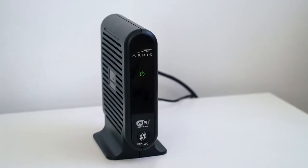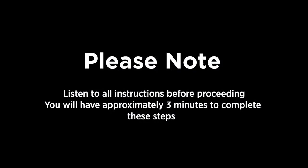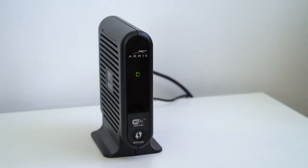At this point, return to your video access point. It is important to note that the following steps will need to be completed quickly. Please listen to all of the instructions first before proceeding. You will only have three minutes to complete these steps once the process has begun. Press the WPS pairing button located on the video access point and return to the set-top box.